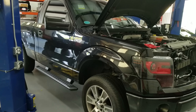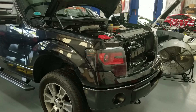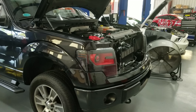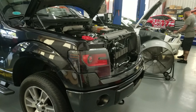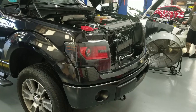The biggest difference between the F-150 and the Mustang coyote is the cams — they're a little smaller, and there's a little lower compression on F-150 coyotes, but not enough to really matter. The intake cams are the worst things on the planet on these trucks — the intake cams are just different.